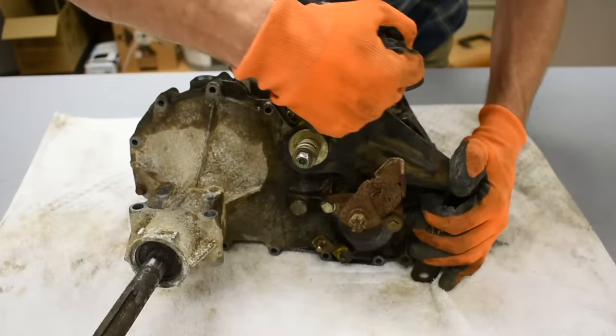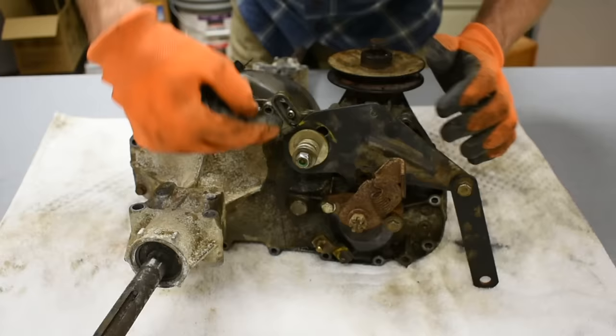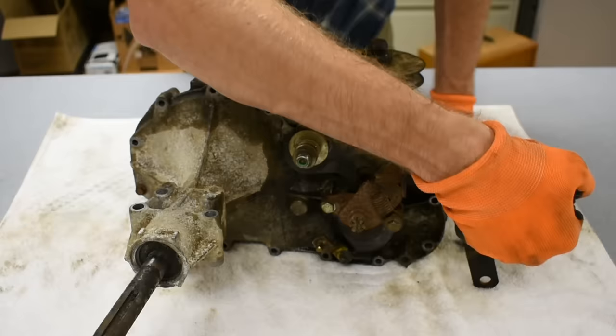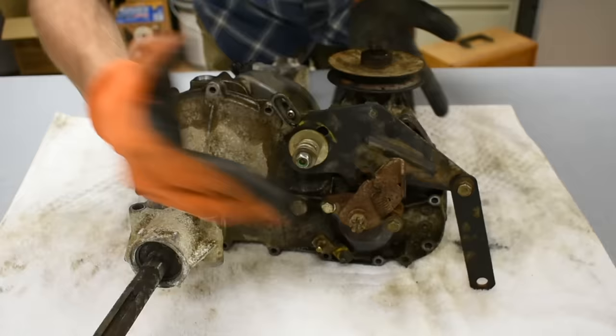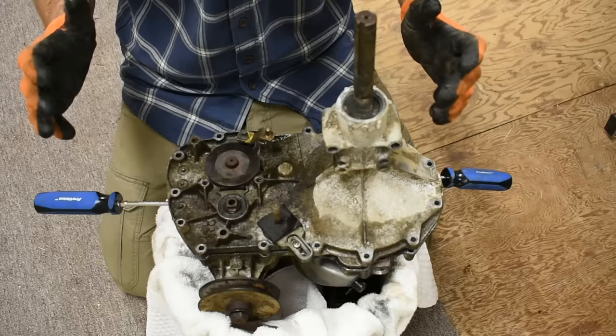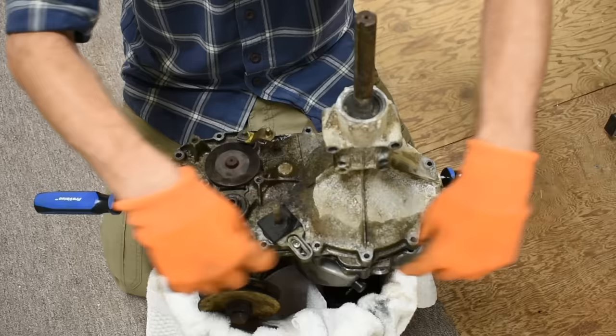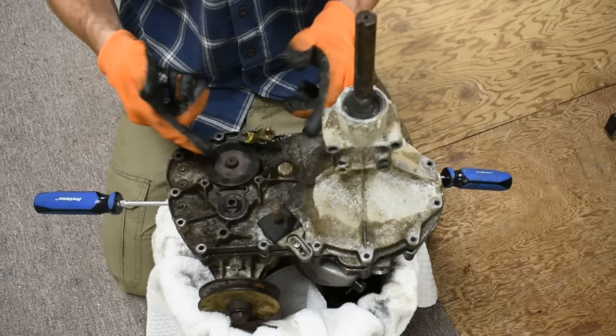It's called hydrostatic because instead of having a gas pedal or individual gears, we simply move the stick to a position and let it sit there. This little piece with the spring provides friction so that the handle doesn't vibrate to a faster or slower speed while driving. That's what it looks like on the outside. Next we'll take it apart and look at the gears inside and the whole mechanism that causes it to change speeds. Here's the side view where the wheel would attach - let's go ahead and take the top off.